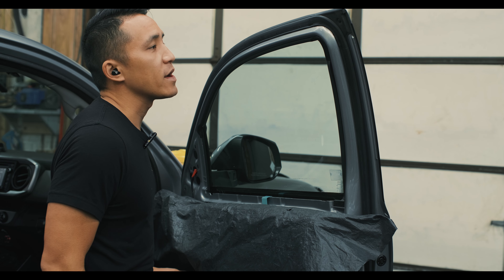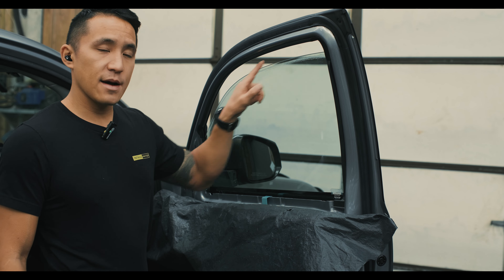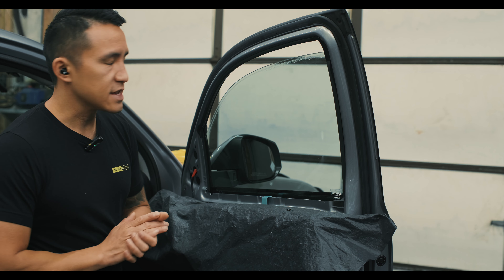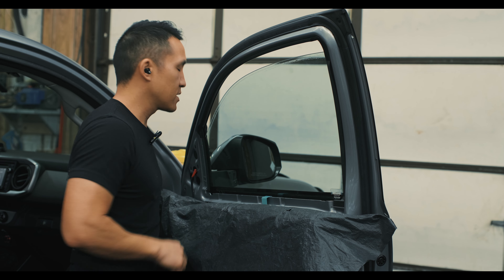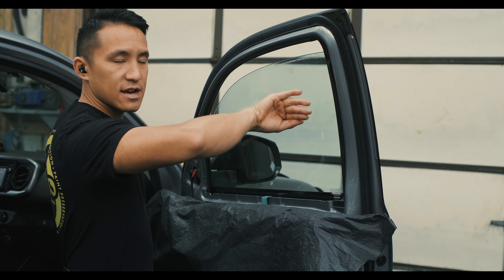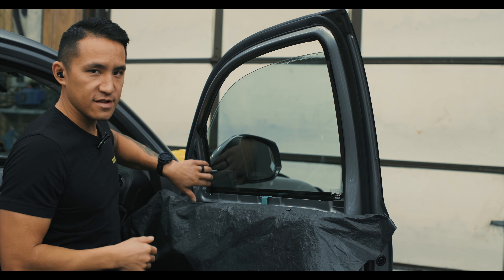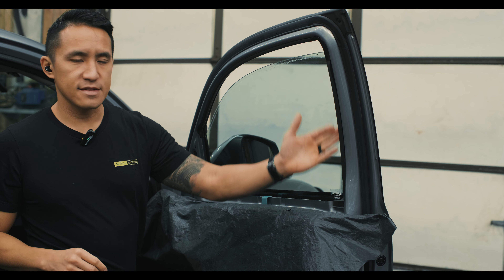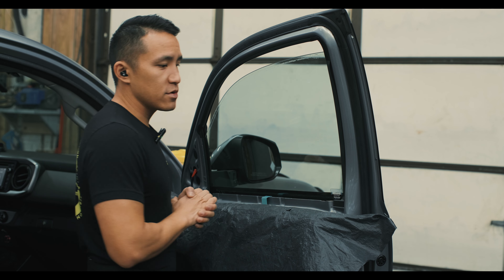There are a few areas on the inside glass that are very crucial to clean. Number one is this top edge — it likes to hide and tuck itself into the gasket, and a lot of dirt gets collected up there. Even if you meticulously clean every day, if you're not a window tinter you're generally cleaning your glass without running across this top edge, so it always collects the most dirt. The other key points are the gaskets on the sides — when we wipe we're automatically stopped by the gasket, so we want to flush those sides using a lot of slip solution. Top edge and corners are very hidden, very dirty, and hold a lot of contamination.